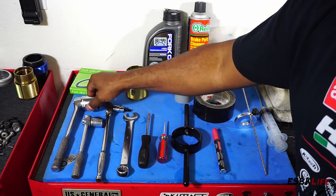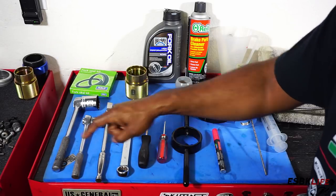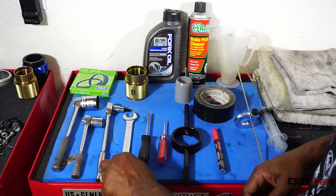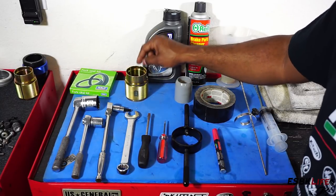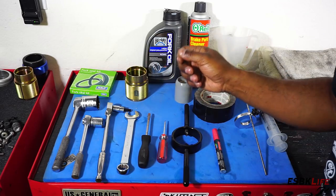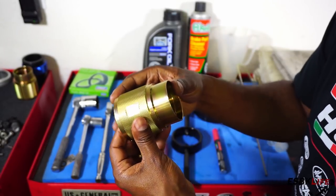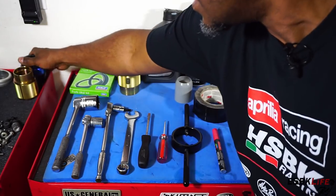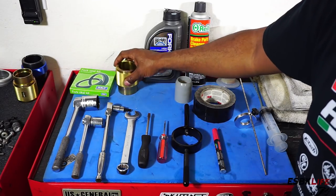You're going to need a 30 millimeter socket and ratchet — I have a half-inch drive on this one. You'll need a 19 mil socket and ratchet, and a 7 millimeter Allen socket and ratchet. You can use the same ratchet for all of those. You'll also need a 19 millimeter crescent wrench and a couple of different flathead screwdrivers. You are going to need your fork seal driver — for this particular bike you need a 50 millimeter one. This unit works from 49 to 50 millimeters. I have a couple of others: a Motion Pro 48 millimeter and a 43 millimeter. Depending on what you're working on, make sure you have the correct size.